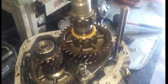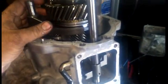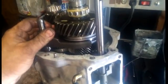This is what it looks like inside: sixth gear, fifth gear. Like I said, this is only my second rebuild. Actually, my apologies — I believe that's reverse. I'll play with it and figure that out. Down at the very bottom is fifth gear, and that's sixth gear, and reverse. You can see the reverse is the old bronze synchro. And this is part of the countershaft — fifth and sixth right down here.